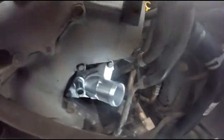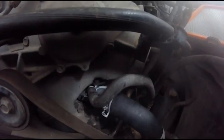I'm sure there are mechanics and other professionals looking at this saying that is not a clean surface for another gasket, but that is as good as it's gonna get. There's gonna be a new gasket sitting up against it. I thought I'd be done with this entire process in about an hour. Behold the new thermostat, shiny and new. I'm gonna put a little soapy water around the top of it just to make the hose slide on. These are hooked back up.